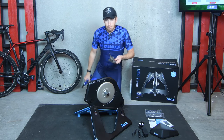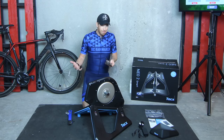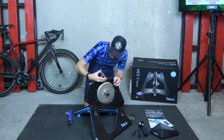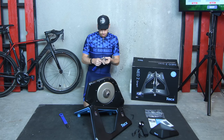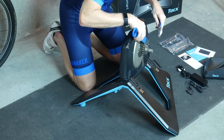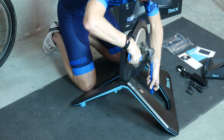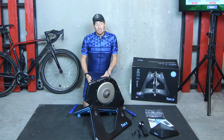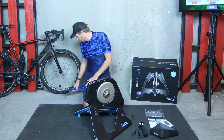Here is my cassette — not brand new, but I've given it a nice baby-wipe clean. I also cleaned up my drivetrain earlier, so it should be relatively clean. The installation takes just a couple of seconds. Take the cassette lock ring tool, stick it on and in, take the chain whip tool — which I will 100% do wrong the first time — tighten it up. You want to check that there's no play in it; if there's any play you've screwed something up. This is actually one of the first times I've done it right without play, so I'm like one for a hundred.